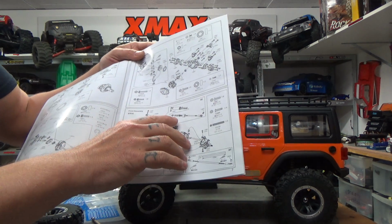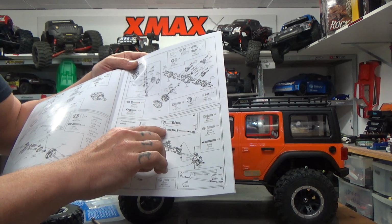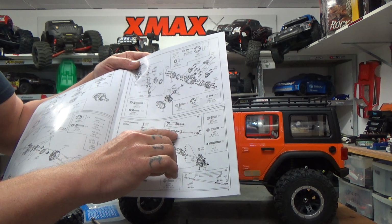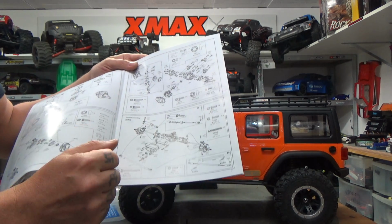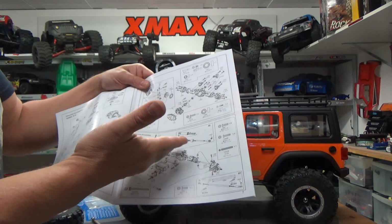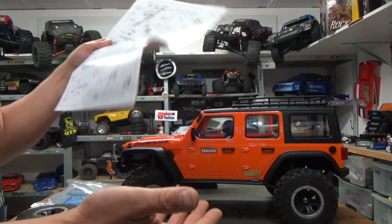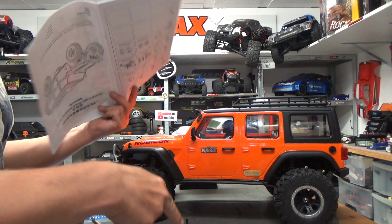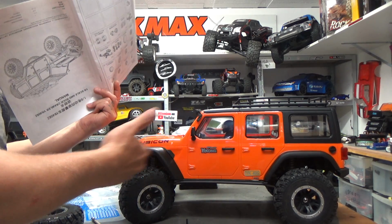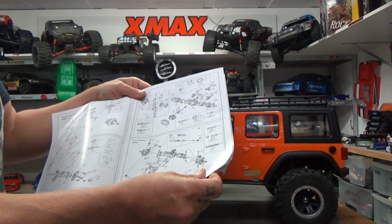The damper is filled with oil. You have a piston and two springs, one before and one beneath the piston, to keep the steering centered. You don't especially need to have oil in there, but you can. I had oil in there out of the box, but it comes out, so I have no more oil in there, but it really doesn't matter for me.